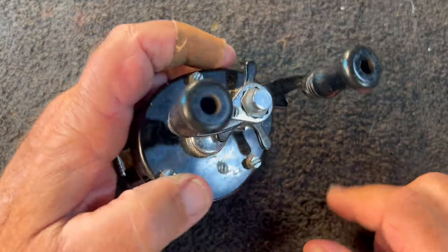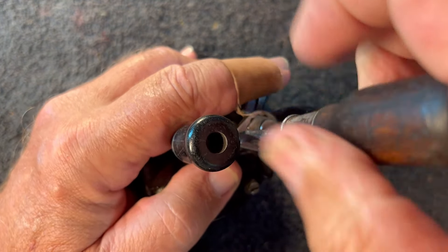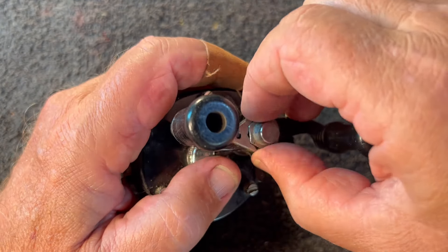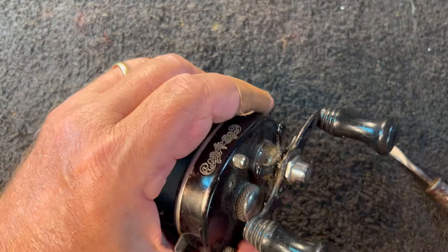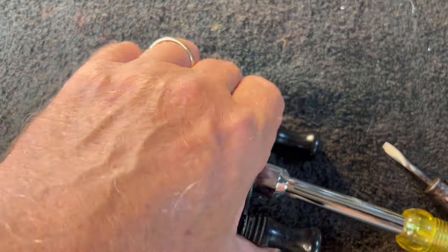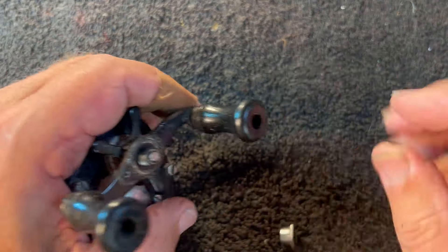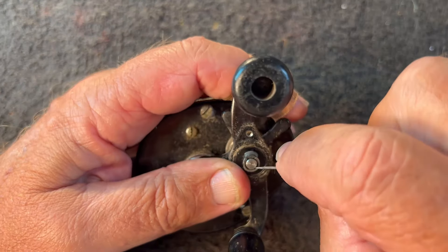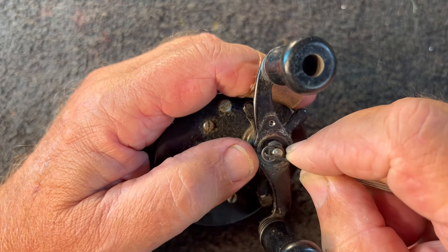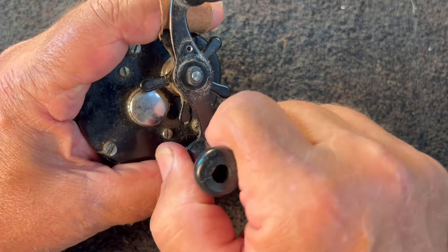Let's start off by removing the locking screw for the nut. That takes the screw off, that takes the locking nut off, and now we'll see about taking the nut off. Let's see if this looks like it'll fit — yeah, it will. All right, we have an E-clip here. We're going to see about taking that off. There we go, there's the E-clip off. I'll set that over to the side along with the handle.